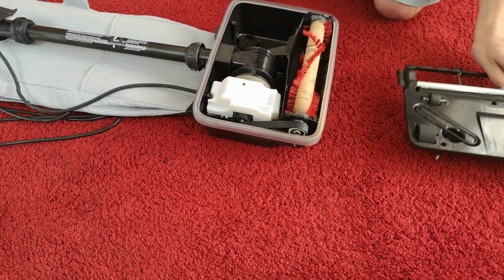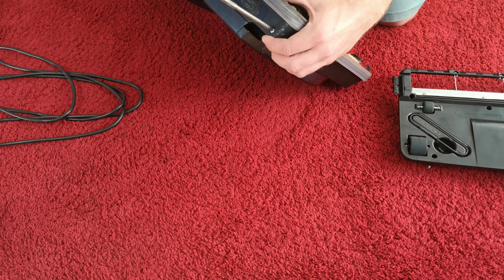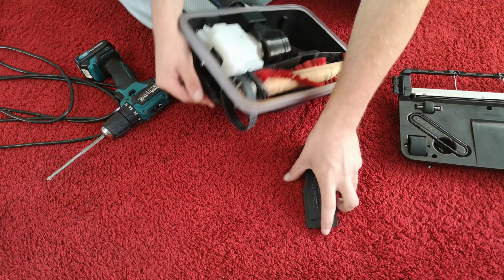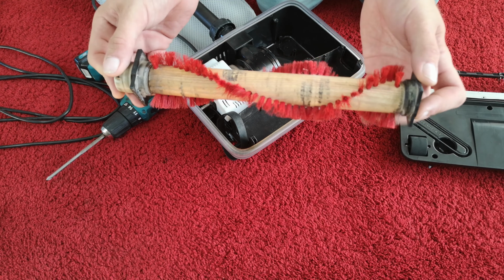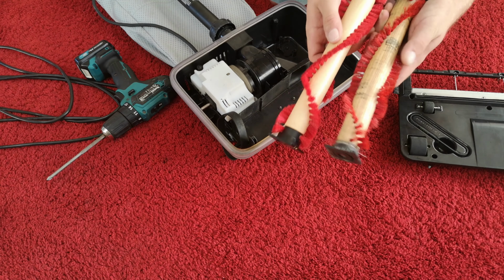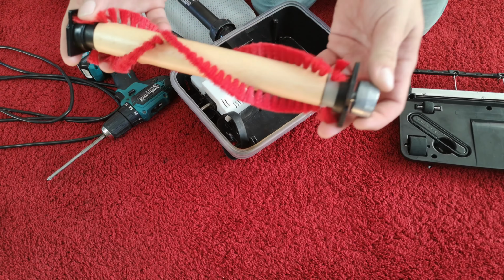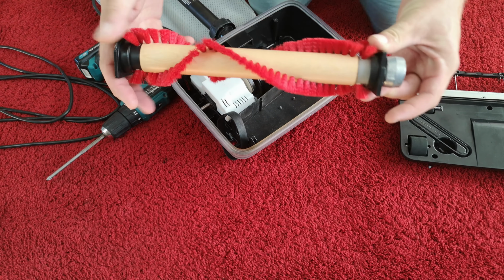We remove this bottom plate, we can see our brush roll, which is terrible. I suppose we best also remove the belt fitment cover in order to slide the belt off of the motor pulley and take this out. Yeah, this brush roll, I mean, it would do, I suppose, if this was your own machine, but for, I think, £11, we have a very nice, non-genuine, but brand new wooden brush roll, and it looks better than this one, because it's got the metal-style belt pulley, which the green one actually has itself. So, yeah, nice, brand new brush roll.